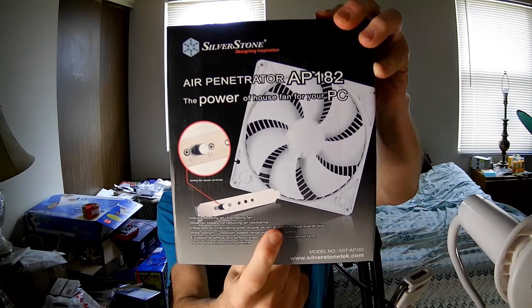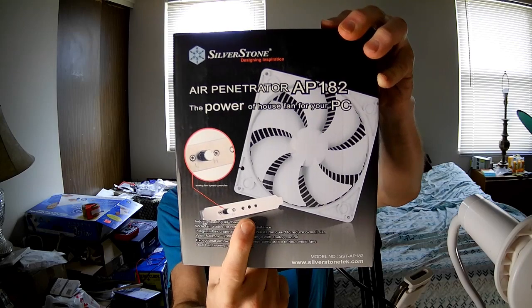You can even have a second fan installed in that space. You cannot use a power adapter that is for 7 volts, because that will mess it up. Also, this fan is over 1 amp at maximum — 1.3 is the safety rating — so a lot of headers are not going to be able to handle this fan. You'll probably need a fan hub, fan controller, or some other power source to use this correctly.